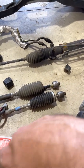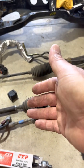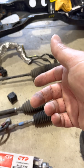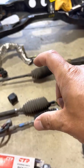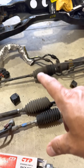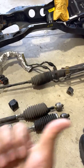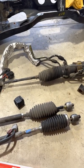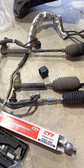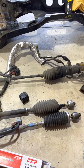control arm. Now that being said, I could drill the control arm. There's enough material there. I could drill the control arm and use the 15 WRX end links, which I think would work. I gotta double check. Factory ones wouldn't, but an aftermarket one that's adjustable would, because then I can put one this way and one that way on the end link, one to the inside, one to the outside, and then it'll work good. So I'll post some videos on that later once I get the absolute results finalized. So anyways, that's where I have been on this project.